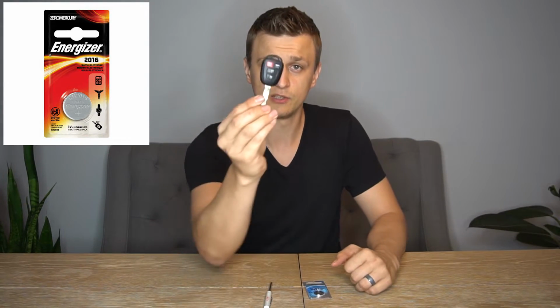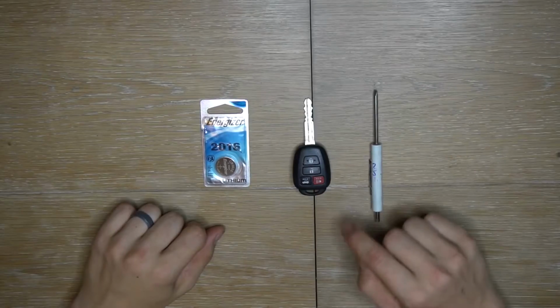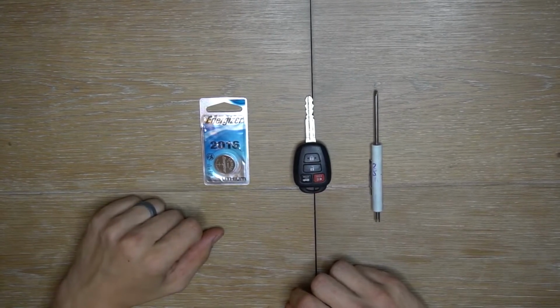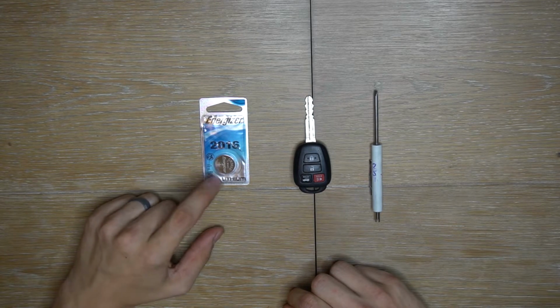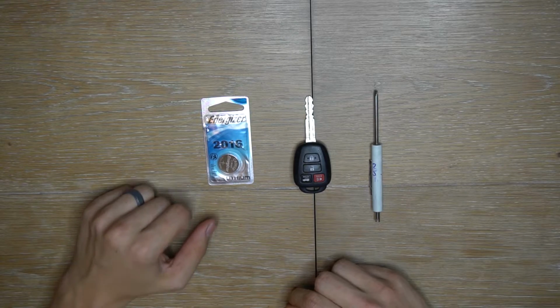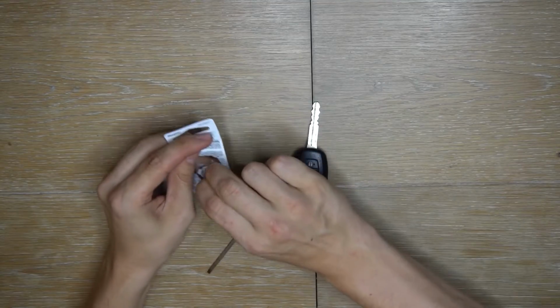I ordered a battery off of Amazon, and if you have a key that looks anything like this, I will show you how to replace the battery on it. All you will need is a little screwdriver, a butter knife, or some kind of pin that you can wedge in between the plastic casing to open it up. My key fob, and as far as I know most Toyota Camrys, uses a CR2016 3-volt battery. I'll put a link in the description of the one that I got on Amazon. So let's go ahead and open that up and show you how to put that in.